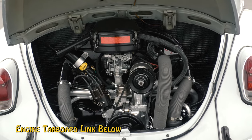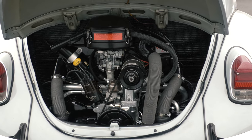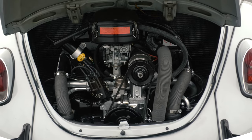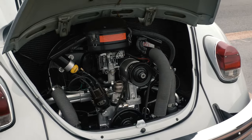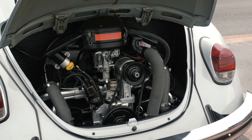The tarboards look really good. We did a complete ground-up rebuild of this engine — big bore piston and cylinder kit, so it's a 1641cc. We went with a mild upgrade: the Scat cam, just a mild upgrade, and we threw in solid rocker arms and rocker shafts.